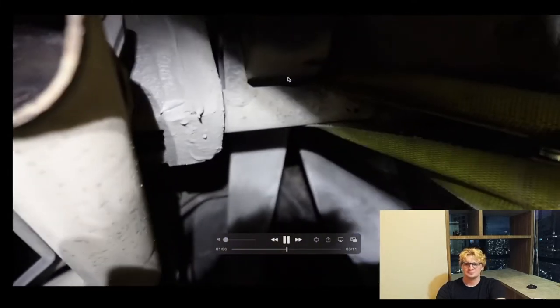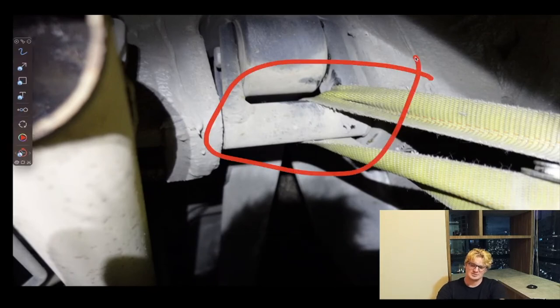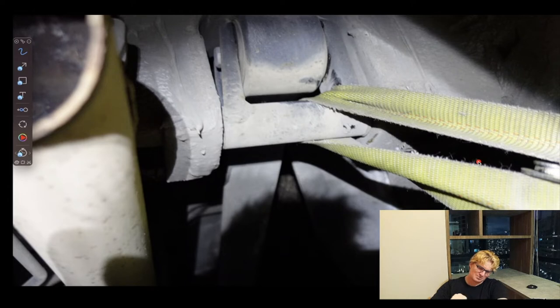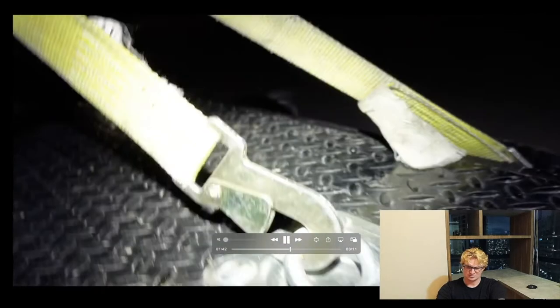So let's look right up here. This is the area you want to utilize to compress the rear shocks. Just like before, wrap that strap around, get that ratchet strap, and just crank it down as hard as you possibly can — as tightly ratcheted down as possible. Goes right onto the trailer, just like the front.